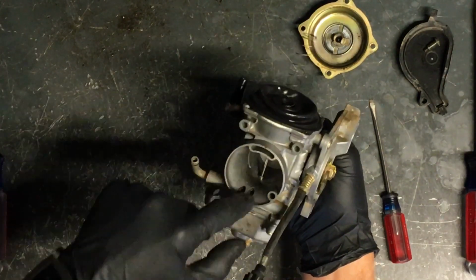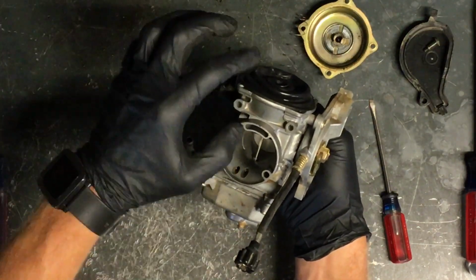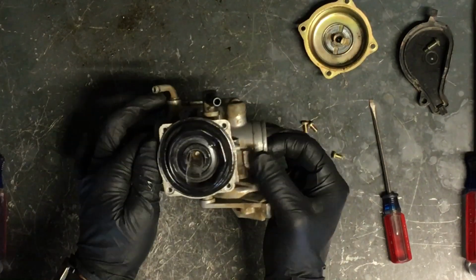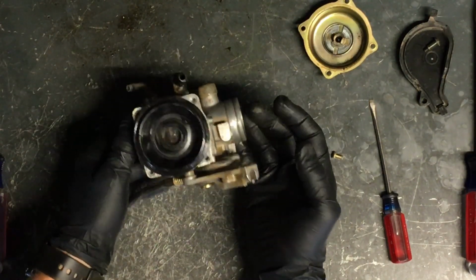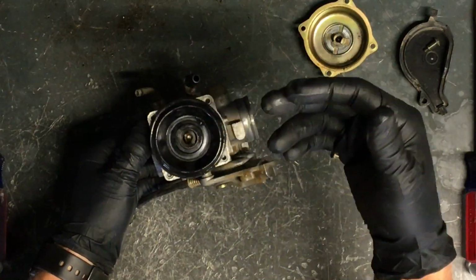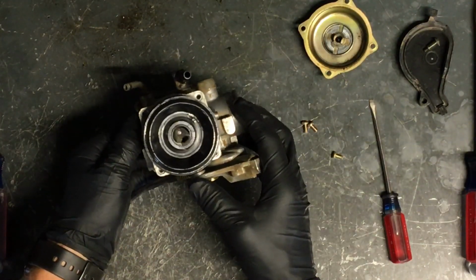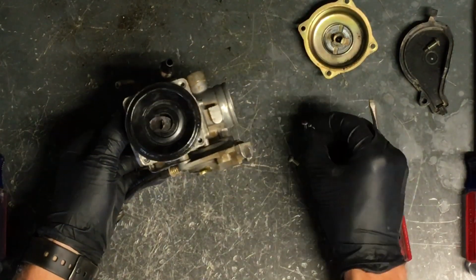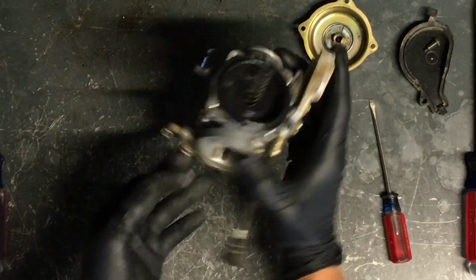And remember, when we pushed air through here, this slide went up. It will not do this if that's not sealed properly. So you want to let that dry out first. A lot of times I'll just stick it in the window, stick it in the sunlight, where it's going to get some airflow, and that'll dry out and it'll shrink back down. You'll be able to fit it right back down. Put the Phillips screws back in and you are all set.